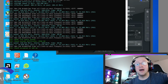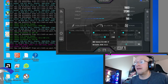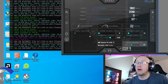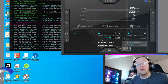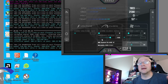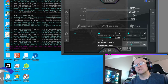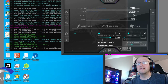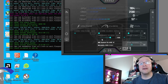And what happened was, when I would go to overclock the 6700 XT, I couldn't overclock in Afterburner. I tried 3 or 4 different Afterburners and I could not get it to pull in. Nothing would unlock. So core voltage showing locked, core clock locked, memory, even when I would adjust it, would revert back. So then I would have to overclock in the Radeon software, but when I would do that, it would try to fight the 5700s and mess up their clocks, even though I had them turned off in the Radeon software. So the moral of the story is Windows does not like to use 2 overclocking softwares, and that was the problem. Once I finally got them to work in conjunction, after 3 hours of initial setup and 2 hours the next day, I finally got it all optimally running.